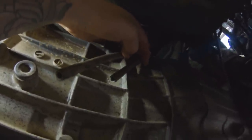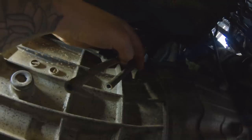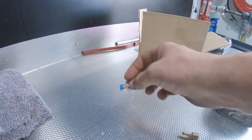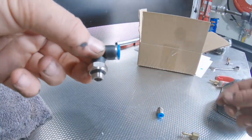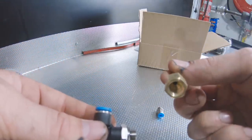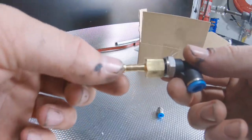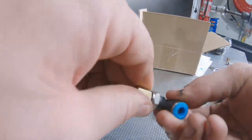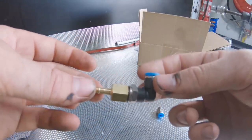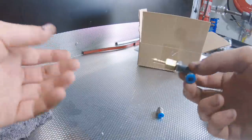We're going to tap into the factory lines and run it over to our breather kit. I decided to use one of these fittings on the rear diff because it goes straight up, so I'm going to have to use the angled one on the gearbox and transfer case breathers. Like I said, we've got a little brass eighth BSP female barb - we're going to push the standard factory hose onto this barb, and that's going to allow us to use the push lock fitting, run it over the gearbox and up to our breather kit. Going to go ahead, lock tight that on and fit it all.